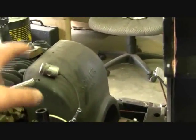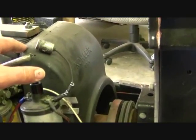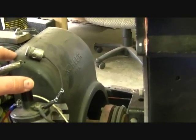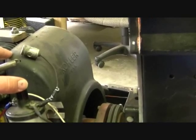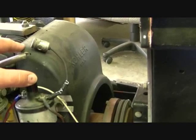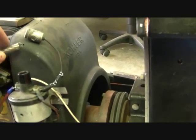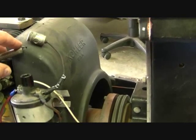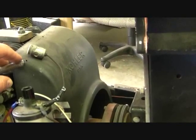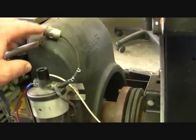Technically this is not thick enough, because if you're spinning this at 7,500 RPMs, or say even 6,000 RPMs, you could fly apart. You never know, and I don't want to take any chances, because it's pretty fast, and when something flies apart, it's going to go everywhere. There's a video or a slideshow on YouTube, or maybe it's on one of the tractor forums, I can't remember, but I saw pictures of what it can do, and it tore some stuff up.